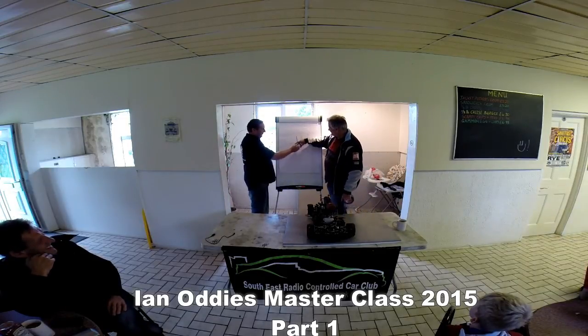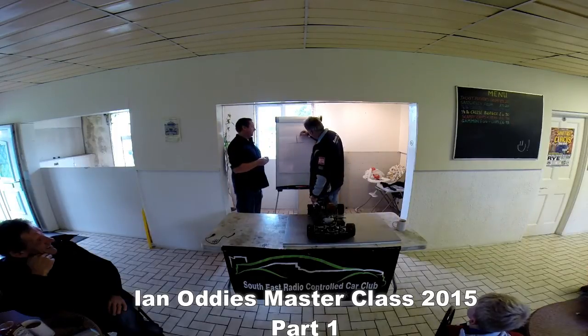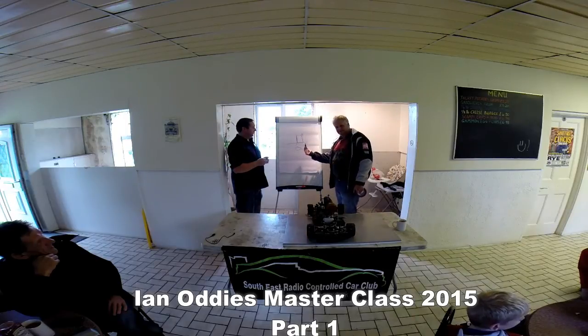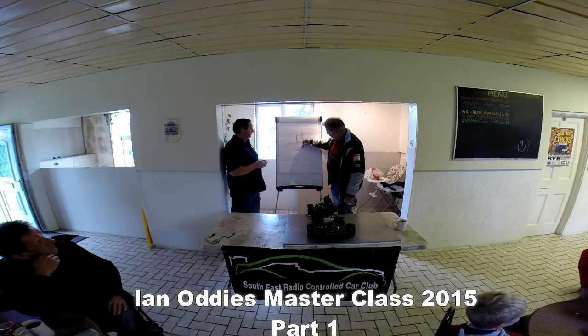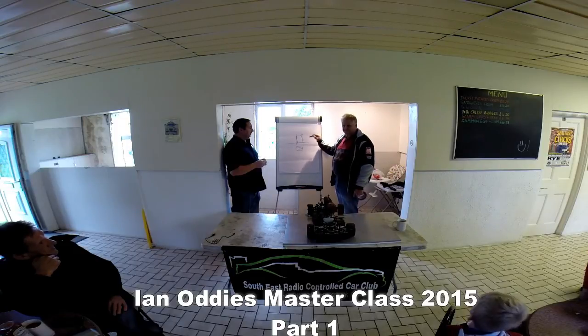Obviously, you have a line from the middle. If that's straight, we've got say 2 degrees of camber there, haven't we? Yeah. The footprint on that will look like that, if you go underneath the table. So when you go around the corner and the car starts pitching and leaning over, that footprint changes, and you get maximum grip. That's half of setting the suspension up.